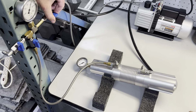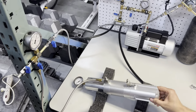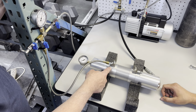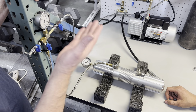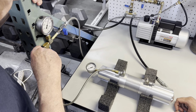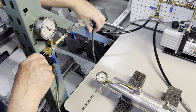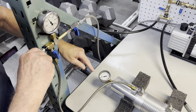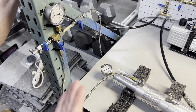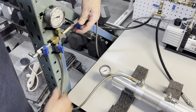Now tip that thing back level — what will it do? When we tip it back level, I'm going to block off the strut for a minute. As soon as the pressure in the levelet is equal to or less than what's in the strut — in other words, the strut shaft is dropping out — I'm going to take this down until we see this needle drop. And it just dropped, so now that valve is open because the strut has dropped out. Put the pressure back in from the strut pumping and it'll pressurize both — that valve is open and it works perfectly.